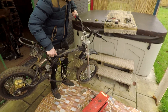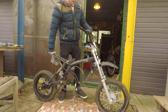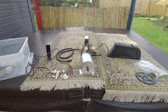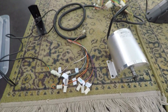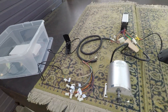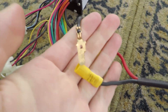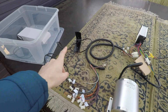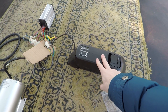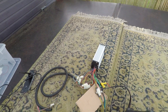Once the chain came off and we'd unplugged the wires, we managed to lift out the big lump of an engine. Here's me showing how light the bike is now — give it a quick bicep curl if you're lucky. Here are all the electrical components we're going to be putting into the pit bike. Me and dad have wired and labeled all of the wires after painstakingly working out which was which, due to a lack of diagrams. The key components we've got are the throttle, currently on a pedal motor. It's 1.8 kilowatts. Here's the battery — 48 volts and about half a kilowatt hour of capacity — and the 1,800-watt motor controller.